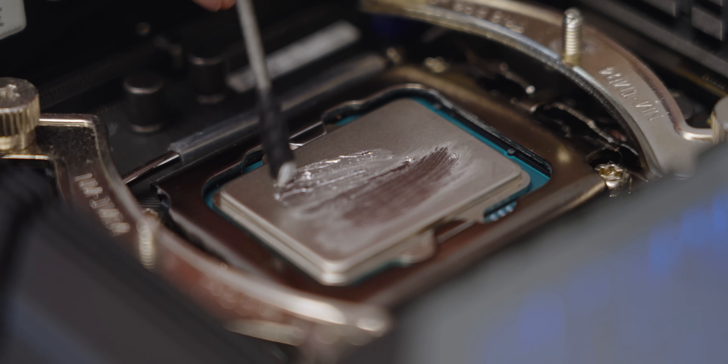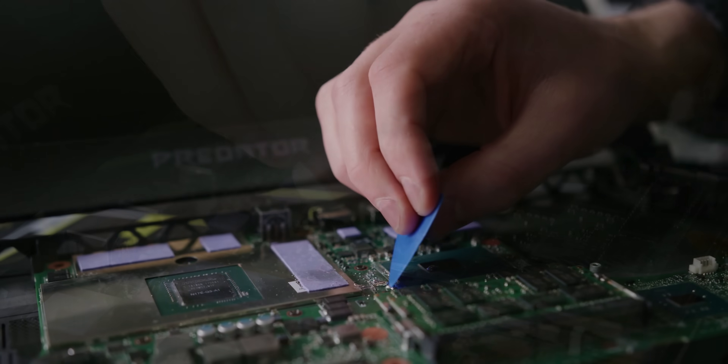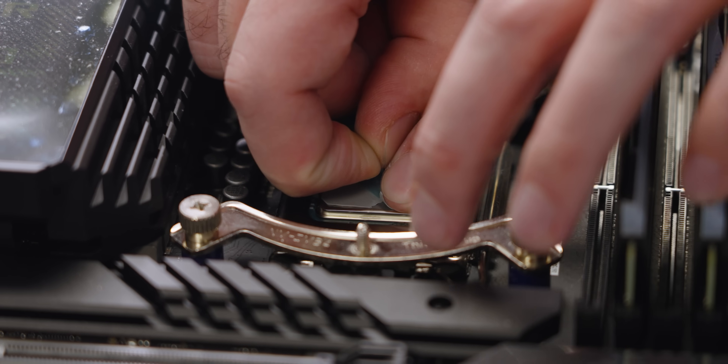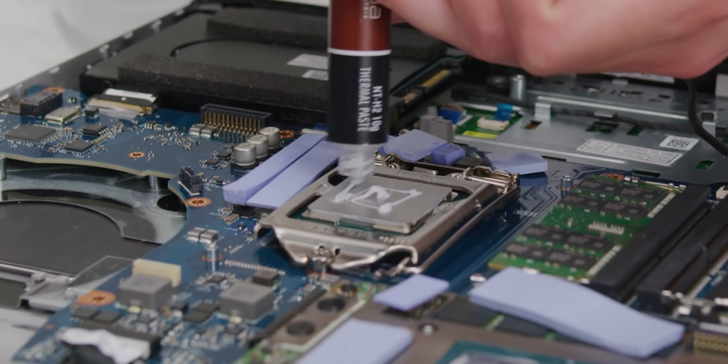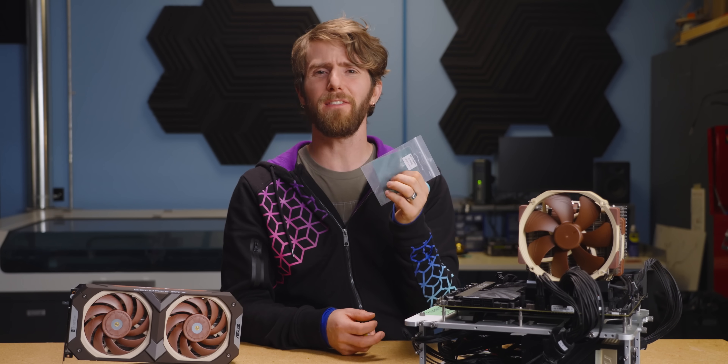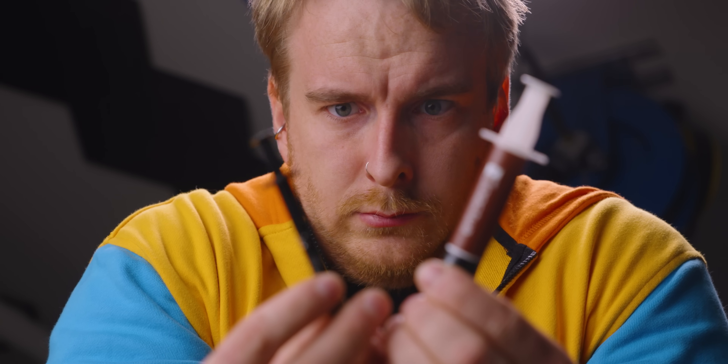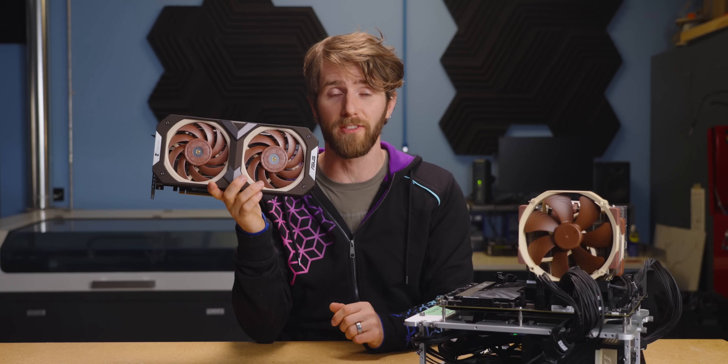Compared to my experience with liquid metal — particularly clean up if you make a mistake — this was not bad. But there's no doubt in my mind that it is a lot more finicky than just squirting out some thermal paste. Even in an unmelted state, the term 'pad' is being used pretty generously here. PTM7950 seems more like a thin layer of schmoo between two pieces of plastic film. But if the performance is good enough, we know that enthusiasts won't hesitate to go through a process like that.